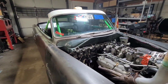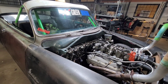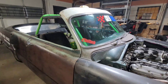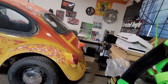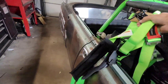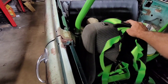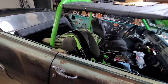I've got a line lock — a ball-style manual valve for the rear brakes — so I can shut the rear brakes off. I do have an adjustable proportioning valve so I can dial a lot of that away anyway. I've also got some race harnesses that have got to get put in.